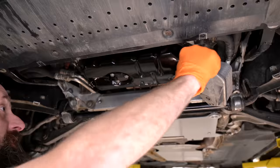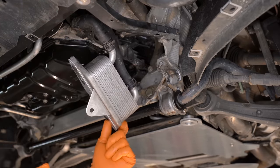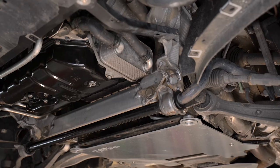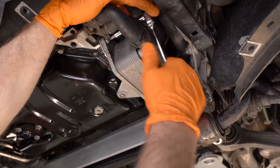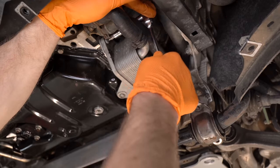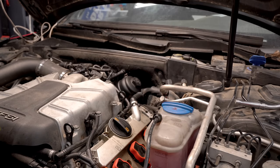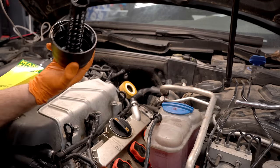I'm gonna have to put the oil cooler all the way back on. I'm putting the old gasket back on — I do have a new one, but we'll do that only on the final time. It would be ideal if this oil cooler wasn't attached to the lower pan as well. I left the back bolt out because it kind of stinks getting in and out — we're just gonna have to take it back off anyway. Put our new oil filter in. I debated on not even running a filter for this first flush, but I decided to just go ahead and do it. I've already cleaned out the housing.